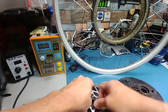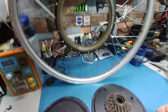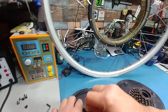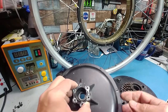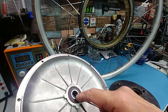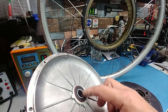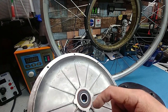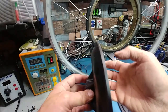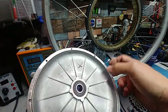What to save — obviously you're going to save your disc brake. I like to save all the screws. The seal — you're going to want to pop that out because you want to save the bearings. You can actually save that too; if you have a hub motor that goes bad it'll keep some debris out of it. You want to keep even pressure on the inner race — don't use a screwdriver and try to bang it out. A screwdriver slipping into that metal ring with rubber on it will physically damage the bearing cage on the inside. You can tell if bearings are worth saving by giving them a spin on your finger — these are not that old and they're definitely worth saving.